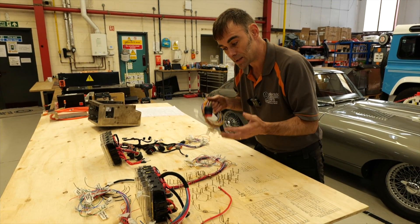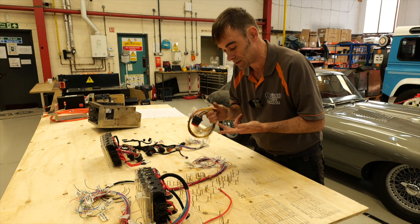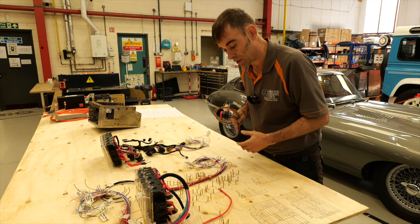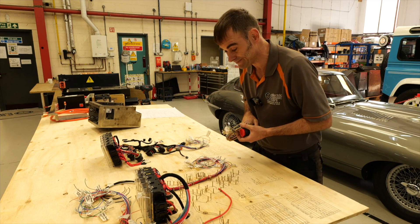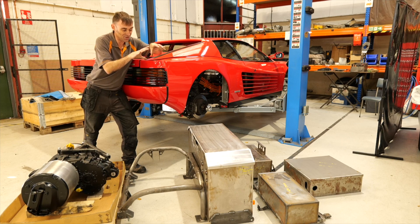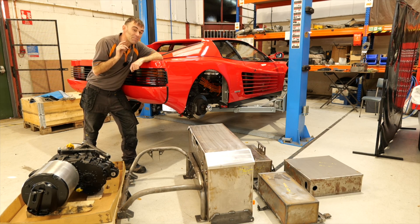Complicated, and takes a bit of time up front to do it. But then in the long run, for repeatability — like we've got the Porsche 911 kit, the Mini kit, the Land Rover kit, etc. — all those kits are on loom boards, so that we can build up a loom with all the plugs in place at the right cable lengths, low voltage and high voltage, without needing the car here. That's why and how we can ship out kits around the world. So there you go — a lot of work just in a small box like that, and we've got the rest of the car to do. We're definitely stepping in the right direction, but there's still a marathon ahead of us. Hopefully in the next episode we'll have that in, these full of batteries, and all of this wiring completed. I hope you enjoyed this episode and we'll see you on the next one.